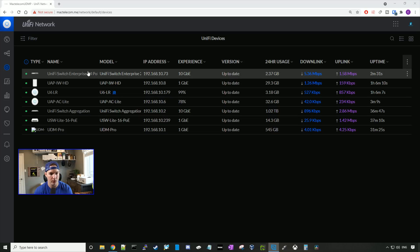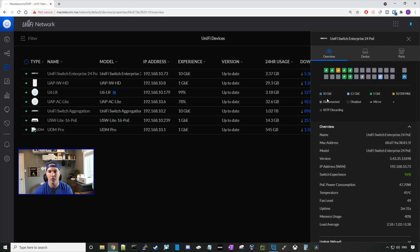Here we can see all the switch ports that are activated. If it's going at 10 gigabit, it shows a blue color. If it's going at 2.5 gig, it shows a lighter blue. If it's going at 1 gig, it goes to the traditional green. 100/10 megabits per second will show yellow. If it's disconnected, we see a grayish color, which you can see on most ports. If it's disabled, it will be blanked out. If we want a mirroring port, we see a little eyeball figure, and if it has power going over it, we see a lightning bolt within the port. We can see the 2.5 gigabit interfaces are working — I have an access point with a 2.5 gig interface plugged into port 20, going at 2,500 megabits per second full duplex.